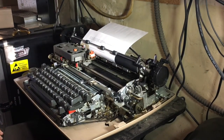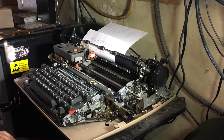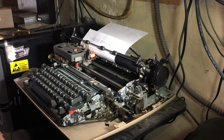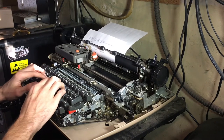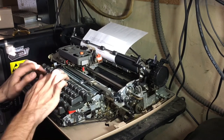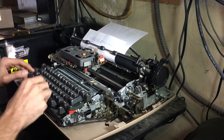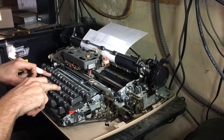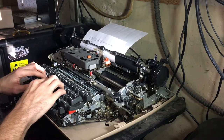When you're just sitting there typing sometimes you can go pretty fast, and you don't want errors in your output. I was just getting a little bit more comfortable with the machine and typing a little bit faster, and all of a sudden it wasn't typing cleanly. When I was able to type slowly it would type just fine. That's basically down to the fact that when you're typing something quick and familiar, those keys get rattled out so quickly that if you accidentally type two keys at the same time, it's registering both keys but doing one after the other. So even if I slowly try to press both keys it won't allow me to do that, but if I press one and then the other it lets me do that.